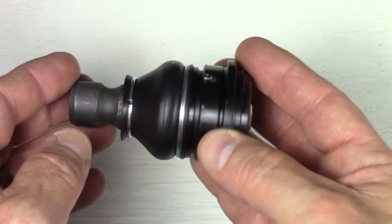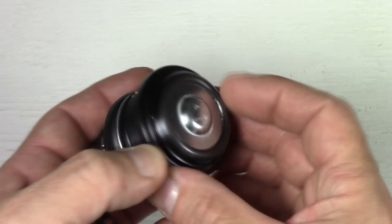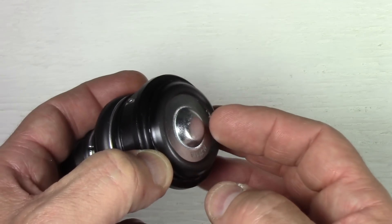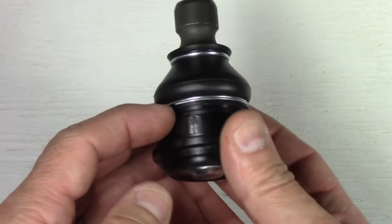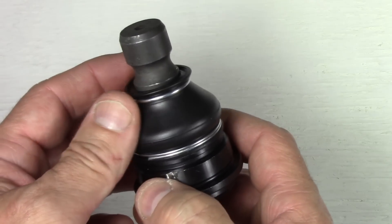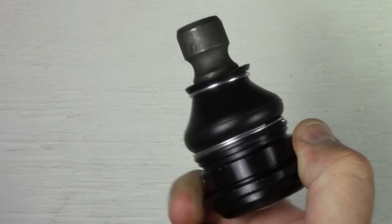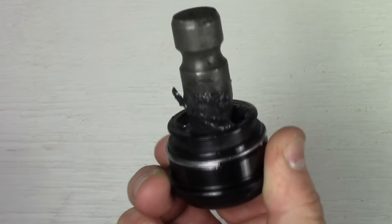I was curious to see if it was lubricated or not. I have no way of finding out if it's lubricated below the ball without drilling it out. On the top, I just removed the boot on my other one — there are two on my car — and I had my vice grips on it trying to get the head to move. It was still so stiff I barely moved it, so I was really concerned. I took the boot off and there was obviously grease there, which is a good sign.